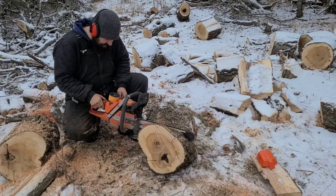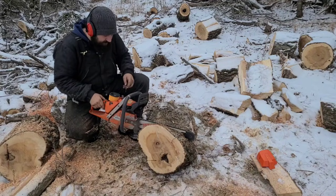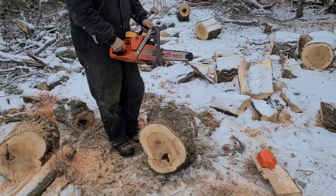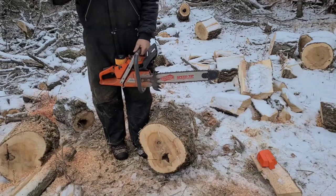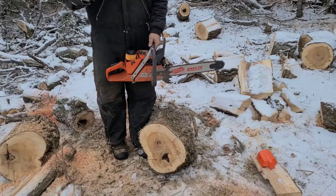Hear that? Okay, I'll take this high jet and turn it in about a half a turn because I turned it right out there. You guys hear it? Four stroke on top. Listen, at the top RPM, you can hear it. You can hear it snarl.